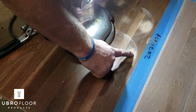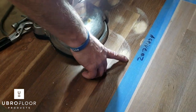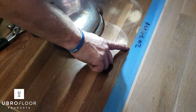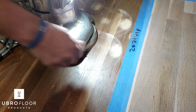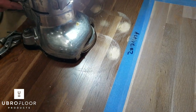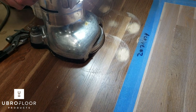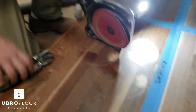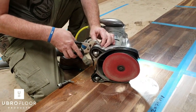There you go — you can see it's right up at the edge. About the size of a quarter is what size you want that cut to be. If you get too low, it will be a little bigger. If you get too high, it will be shorter, smaller — more aggressive. This is what American Sanders likes to see, and that's what we set it at. Once that's set, just lock down your lock nuts with a channel lock so it doesn't go anywhere on you.